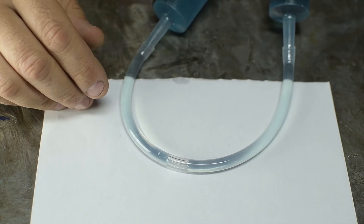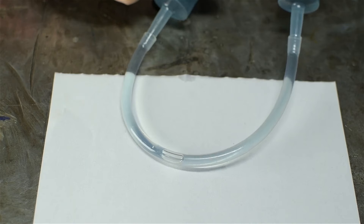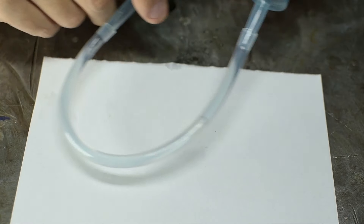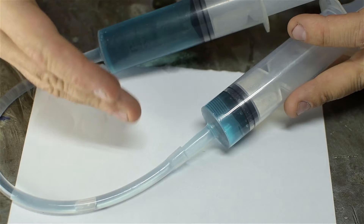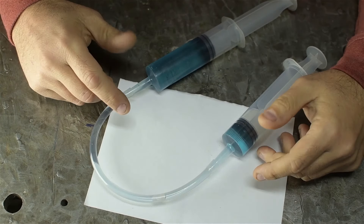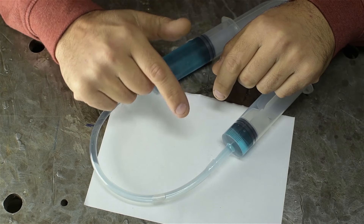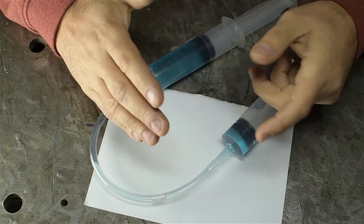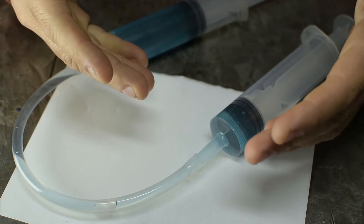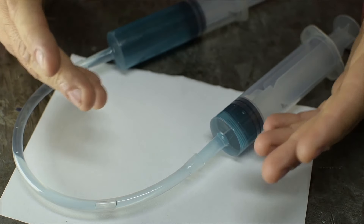A bubble like that is what I thought I was up against. The brake line on that bike is maybe a little crazy — there's a lot of high spots for a little bubble to get trapped in. After all that brake bleeding, after burning through my retirement fund and kids' inheritance on brake fluid, I convinced myself it wasn't trapped air. So now what? The other suspect for soft brakes is a leak — an oil leak. I hit the brakes, the oil is pressurized, but I'm losing that pressure to a leak. The thing about leaks though is you usually see them. You'll find a mess somewhere on the bike or on the floor, but both the bike and the floor were dry as a bone. And the oil level stayed constant. I wasn't losing oil, I was losing pressure.